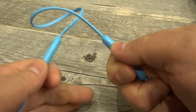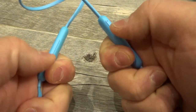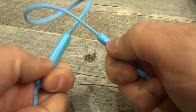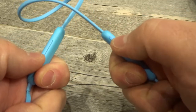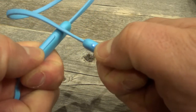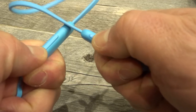To reset them, no matter whether they're brand new or whether you've used them for years, you want to press and hold down the power button and the volume down button for about 15 seconds until you see a red light flash. I'm pressing and holding both of them down right now, and we're just going to wait until we see a little red flash.